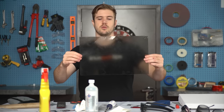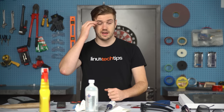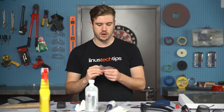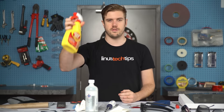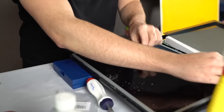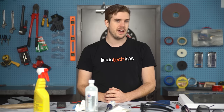Being able to remove the polarizing filter from the monitor and reuse it is cool, but you also need to remove the anti-glare filter — and while it's possible by soaking it in hot water and peeling it off, it's really annoying. The polarizing filters from Amazon are super cheap and work really well. They have a protective film on them which is super easy to take off — not nearly the same problem as the anti-glare filter. Also, whatever paint thinner or Goo Gone you use to remove the glue — let it sit for a while, dry it off, let it sit again, and repeat a few times so the glue comes off evenly. It feels very weird bringing a knife to a monitor screen, but if you do this project, please post it on the forum — I'd like to see your projects.